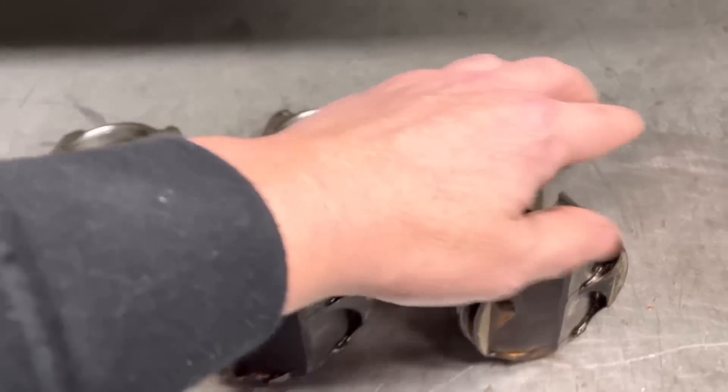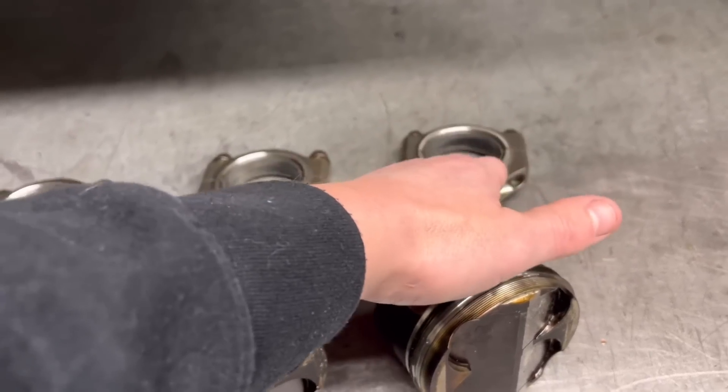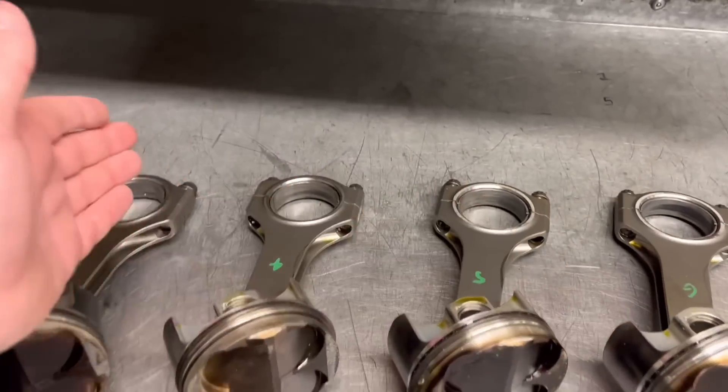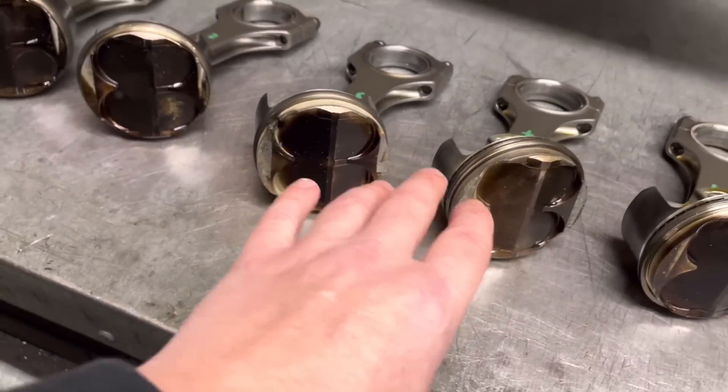It's apparent on most of them. Although crank failure is not the problem of this engine, it is certainly going to wear excessively quickly with the detonation on it. The two centre ones look a bit lighter than the outer ones - that could be down to the injectors. These injectors were not checked, and you could have the centre ones not giving out as much fuel as the other ones, or a different spray pattern. That's probably why, when it was mapped, it could be running leaner on those centre two, which are the ones that have evidently been suffering more with detonation.